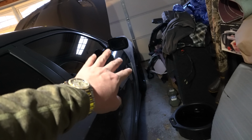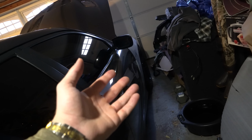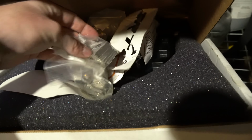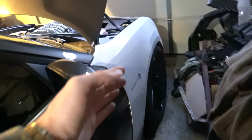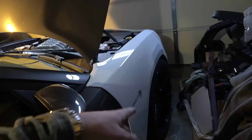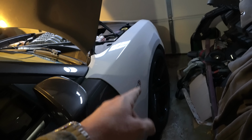settings. What I have on the car right now are some of the more camber plates, not so much caster. Caster's almost stock, but as you can see, it has a little bit of camber to it, rather more aggressive than stock. It's -2.5 degrees camber, and obviously the adjustable upper control arms make that happen, along with the shims and stuff. One main reason why you want that is because when your wheels are turned all the way, the amount of camber can give you a lot more traction in the front, and when you're drifting, you want as much traction in the front as possible.